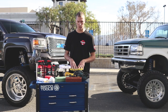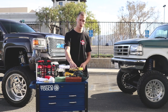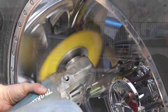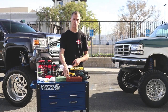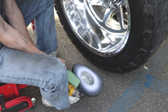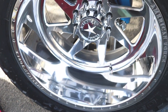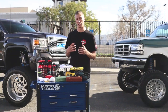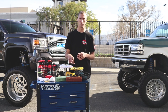Right now, what I'm going to break down is the actual products. We'll start with a cut — this here is a yellow mill treat, and we'll use a brown compound with it. It'll do all the heavy lifting, smooth everything out, and get that nice sheen finish. Then when we're done with the yellow and brown, we switch out to a white flannel with a green compound. Some guys like to use blue, but in my shop I like to use the green. The green leaves that dark, rich chrome shine that everybody's looking for, especially in this lifted truck market — a lot of guys want their billet aluminum wheels to still look like chrome. So we finish with the white flannel and green compound, and I always finish with a variable speed grinder.